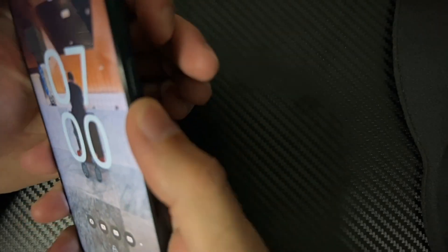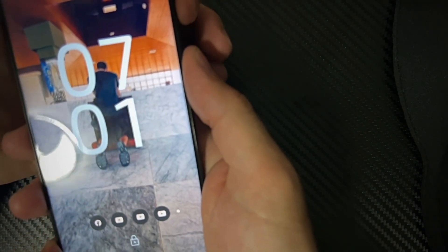Press and hold the volume down key and the power button at the same time and this will force restart it. Now you're going to have to hold down for like 10 seconds, and it's going to take a screenshot if you have the phone on. So let's go to the volume down and the power button — and it's going to take a screenshot, there it is.